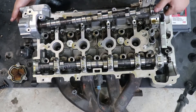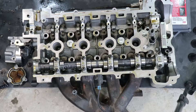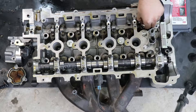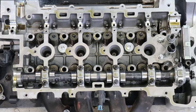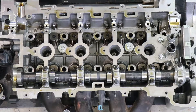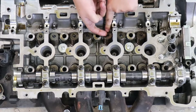On this engine, this high pressure fuel pump housing does kind of stay on there. Sometimes if you lift up the cam you can see it starts moving - you just wiggle the cam up and down gently and that's usually enough to break it off. This is our intake cam - I'm going to take this one off and move it to the side. Next I want to get all my little rocker arms out, putting them in the same orientation I found them so I don't get them mixed up.